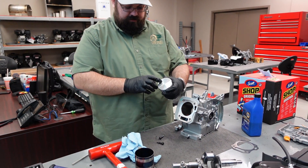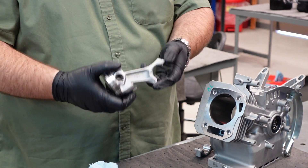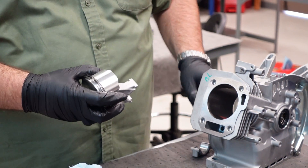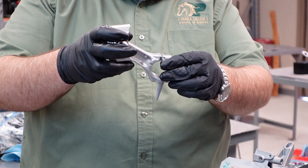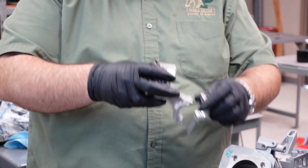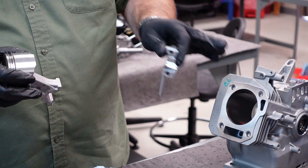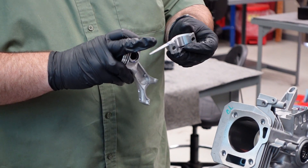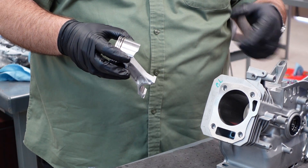Now, you have an arrow on your piston. This arrow points down. There is an oil drain hole here that also points down. When you reinstall this, you have this oil slinger arm that is designed to scoop and sling oil all over the block. It actually slings oil all the way up through this channel where your pushrods go and lubricates the top end of your valve train, and it all drips back down. Although it's just one little skinny piece of aluminum, it does quite a good job getting everything stirred up in there.